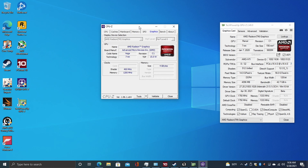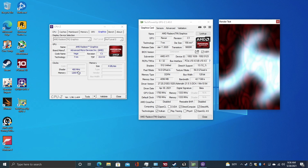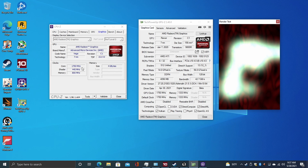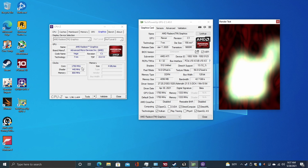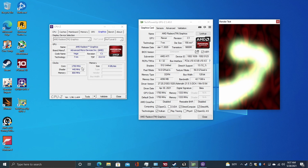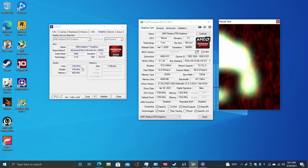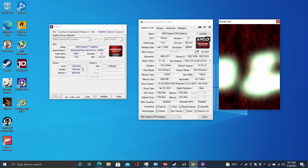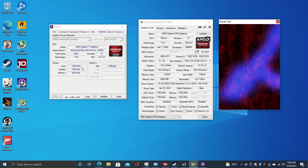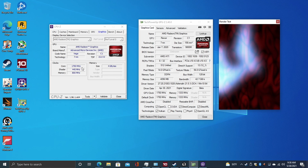I wanted to make sure the graphics were running at their full potential, so I ran a render test and the core jumped up to 1750 megahertz, running like that all day long because of the TDP setup. In the BIOS you can actually change this — lower it or raise it — but in all my tests I find 25 watts is the sweet spot for this machine and chip. Once you go over that 25 watt threshold it helps the CPU side, but it takes away from the GPU — you'll see lower clock speeds in games. So 25 watts is really where it's at with the 4800U.